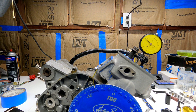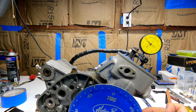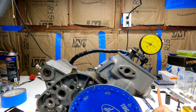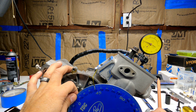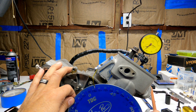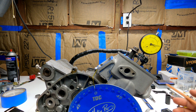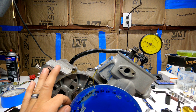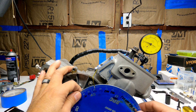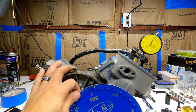Okay, so we have our tools installed. The way I usually do this is I set up the dial gauge when I think it's at top dead center. Right now, for example, I have about four millimeters in. It might not be 100% accurate because this arm moves a little bit, and that's why it's not so precise — but for demonstration purposes it's just fine.